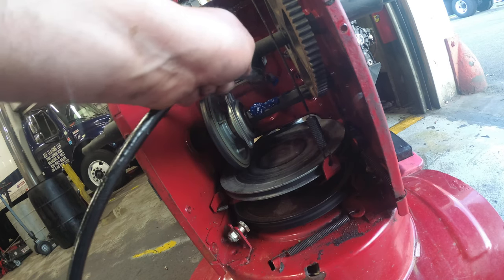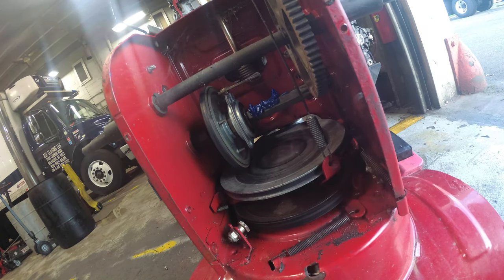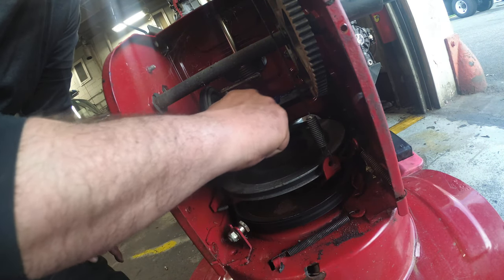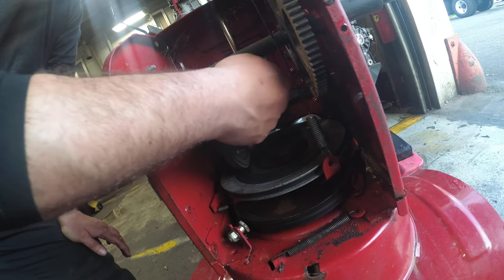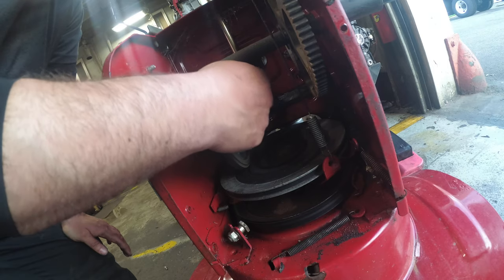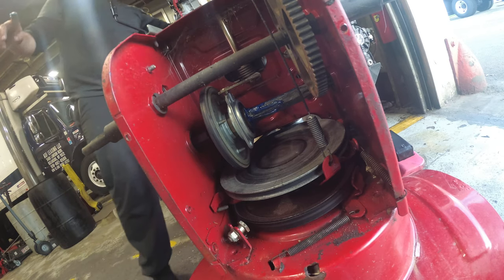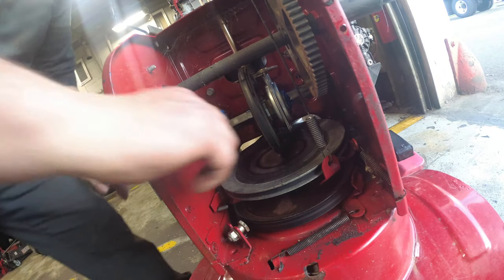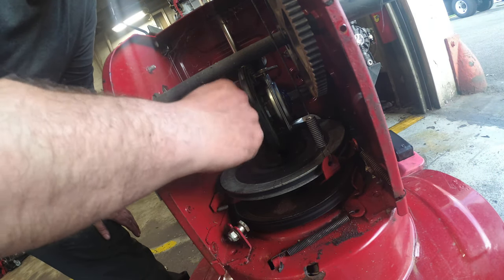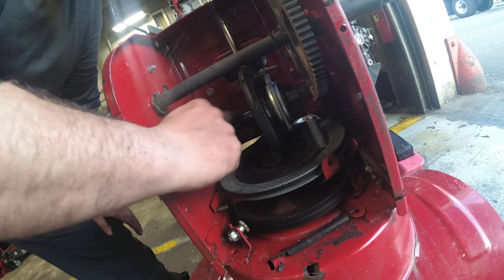Alright, just enough. We're gonna slide that around. Just move this up and down, around, and the excess grease just wipe on the wheels. Take your gear lever and just cycle through the gears the other way, and then you just work the grease on the other side. Pick up the excess grease and just work it on the other side, up and down and around.